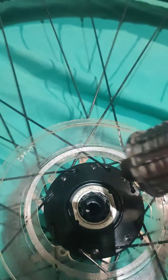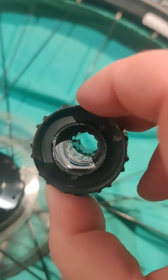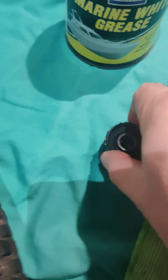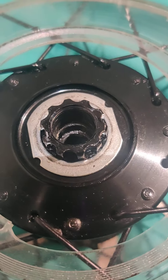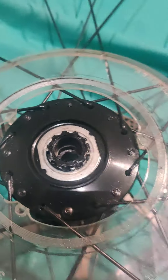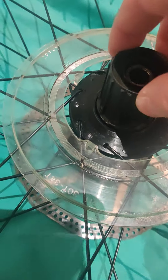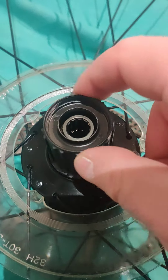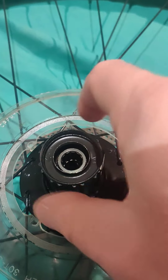I've already loosened this, so you can see that's the freehub removed from the hub itself. Here's the replacement, and you can see there are some collars or tangs on the hub itself that the freehub engages with. With the new freehub you can hear the nice bearing ticking sound as I rotate it.